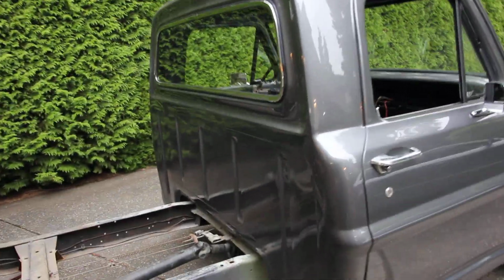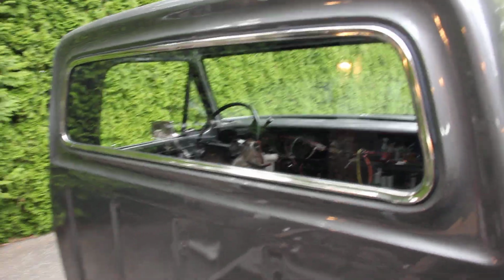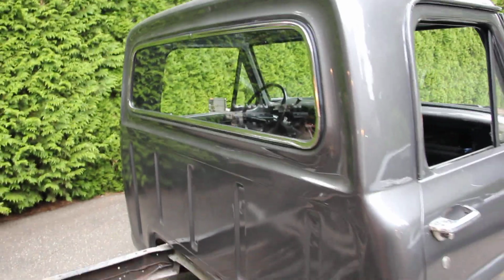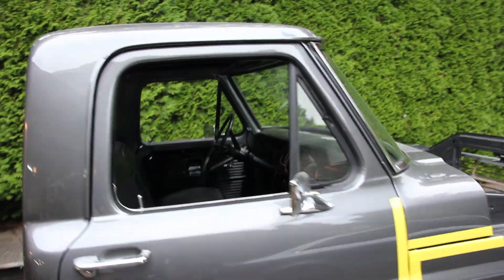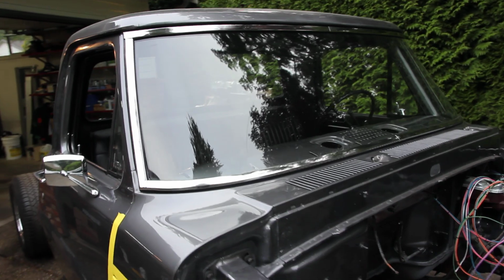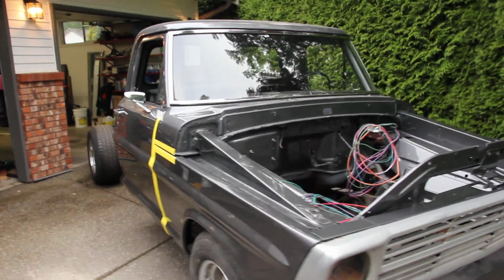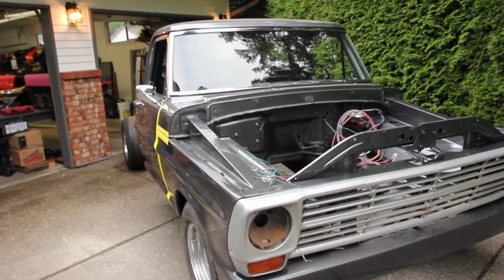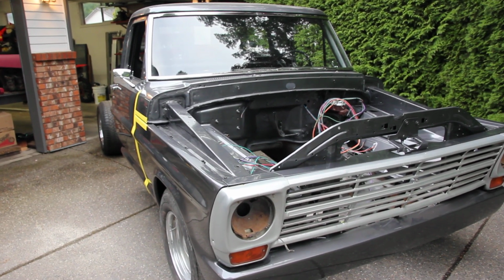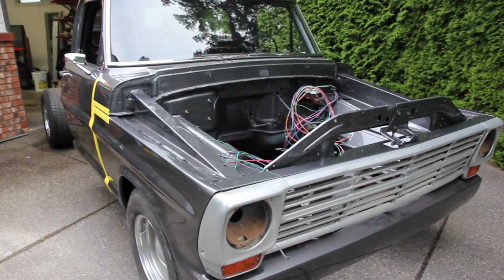Since then, what I've done is I got my glass in, had the stainless all polished up from how it used to be. That took longer than I thought it would. The install, I believe it took 4 hours. It took us 3 hours on just the windshield, 1 hour on the back window. Ask any glass guy, and these are just about the worst possible trucks to work on due to the shape and design of the windshield and the stainless. The shape of it often does not match the shape of the glass.